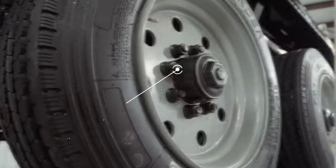This extra-wide deck and drive-over fender combination gives you one of the most versatile lowboy trailers you can get. For running gear, you have triple heavy-duty 9,000-pound eight-lug axles with brakes on all six wheels standard.